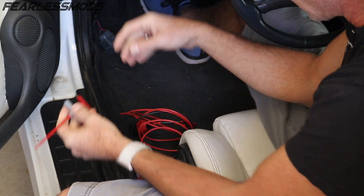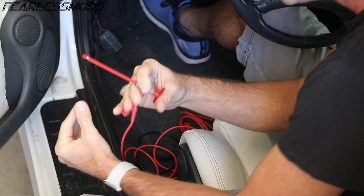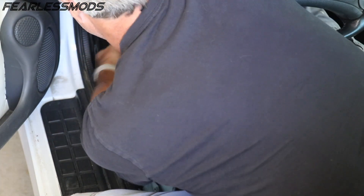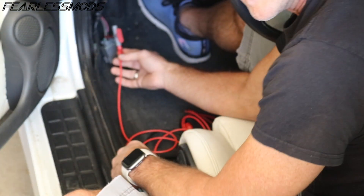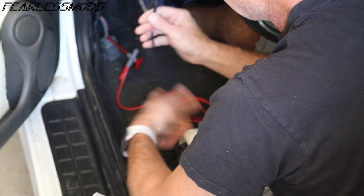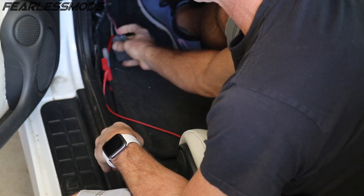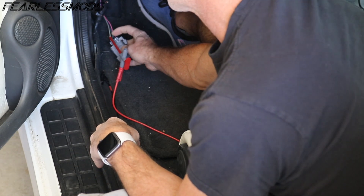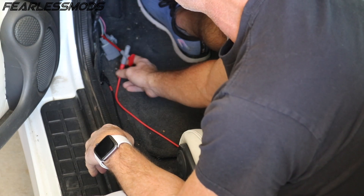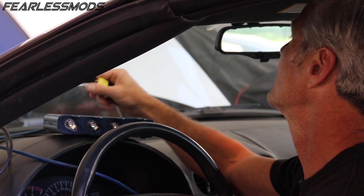For the relay we are going to use an inline pin to grab our gray wire. It's a crappy eBay probe so we'll see how it works. I'll need to ground it, so I'll get a ground and clamp that. The pink wire brings the power in; the gray wire sends it out to the pump, so that should show us the voltage that our pump is getting. Now that we've got all our wires, we'll go ahead and plug them into the Pico.